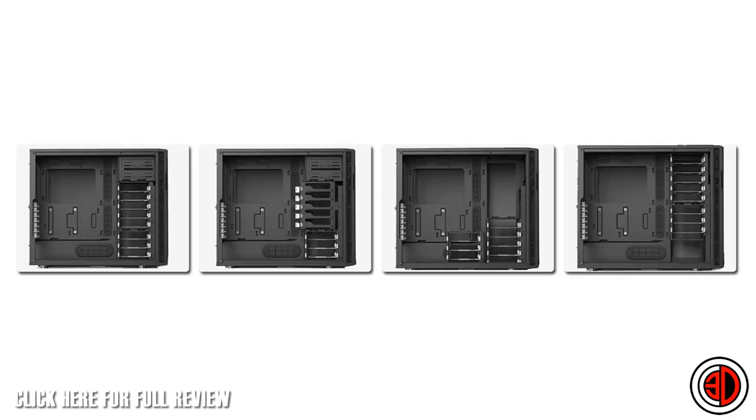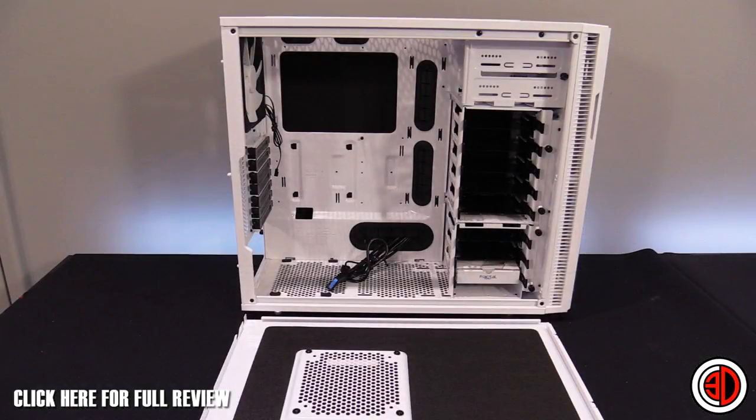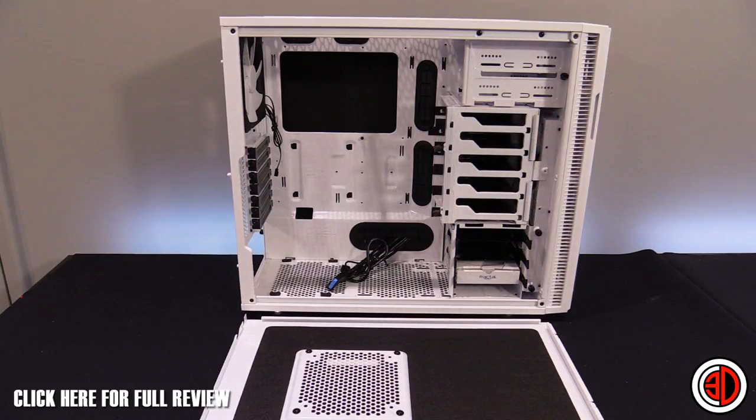There are four hard drive rack configurations. In the original layout you've got the bottom three racks facing normally, but you can spin the top five racks around to a front-to-back alignment. If you've got a big graphics card it'll be difficult to get hard drives in and out in that config, but it's easy to do — you literally just spin it round.